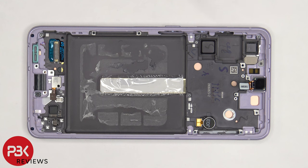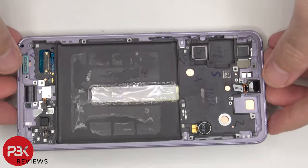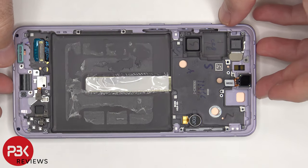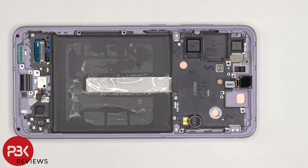If you needed to replace the screen, you'd have to remove the back plate, the screws on the bottom speaker assembly, and remove the speaker assembly. At that point, you'd have access to the screen cable — you'd disconnect that, heat up the front of the phone where the screen is to loosen up the adhesive underneath, pry your old screen off, apply new adhesive, reapply your screen, and reassemble the phone.